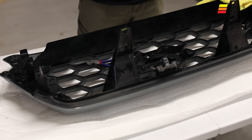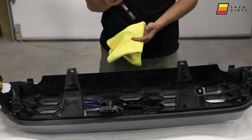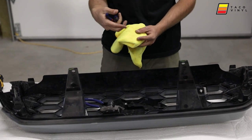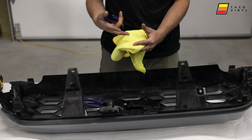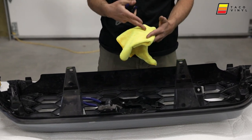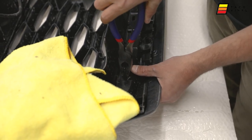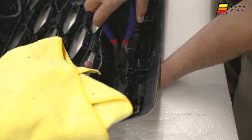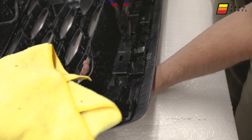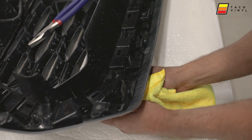To compress the pins and push them through to release the grille, I like to use pliers and a rag. Compress one of the clips, press it through, then compress another one — it'll leave a small gap. Slide the rag into the gap so the clips don't press back up into their spot, preventing them from all clipping back in while you work your way around. The trick is to compress just a little bit, lean it backwards, then press forward and you'll see it push through.